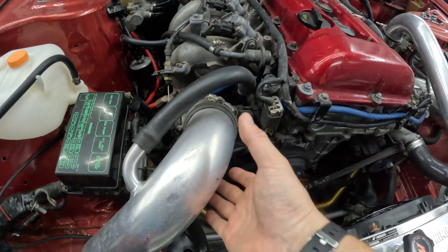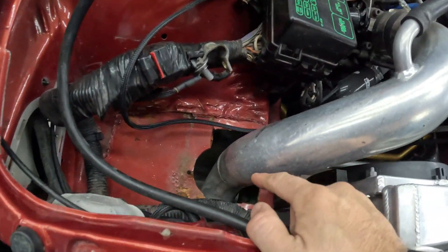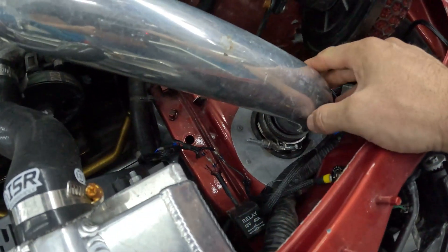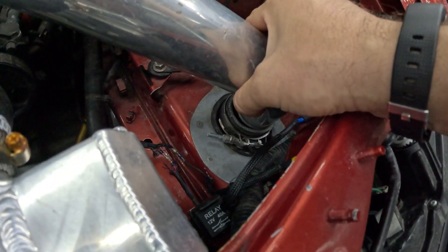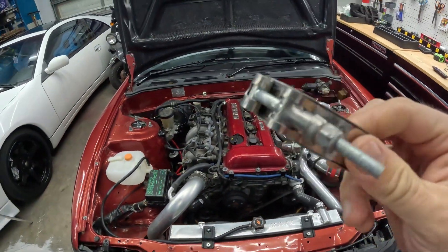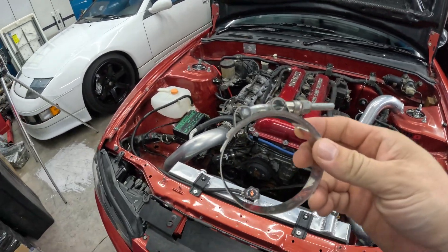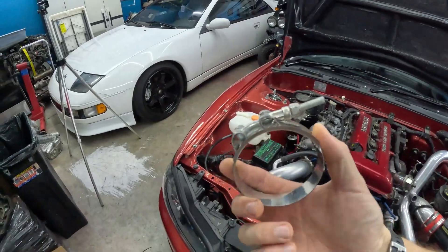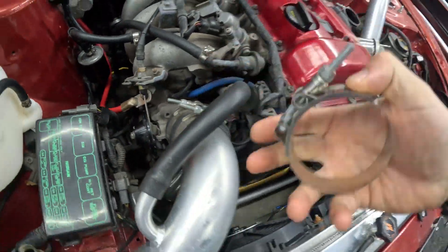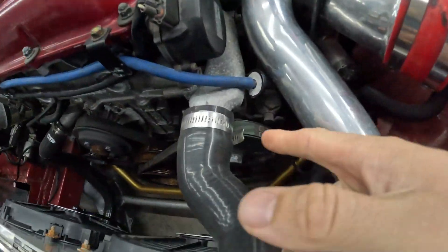This one's turbocharged, so we've got our intake inlet piping here off of our intercooler. Don't look too hard — we've got some rough spots, this car is not perfect. It runs down through here and up over here. I've loosened this up, but as you can see it's not uncommon for this stuff to separate. One thing I've learned chasing down vacuum leaks, especially with aftermarket intercooler piping and couplers, is that boost pressure likes to blow intercooler piping apart.